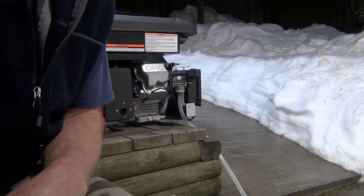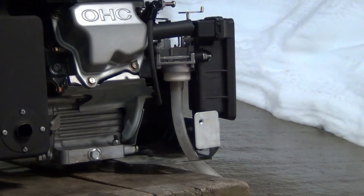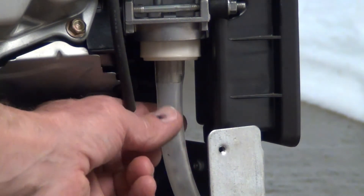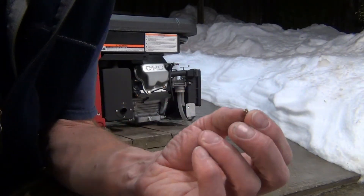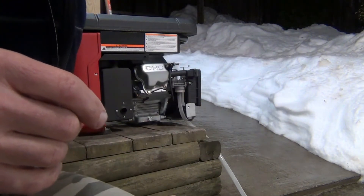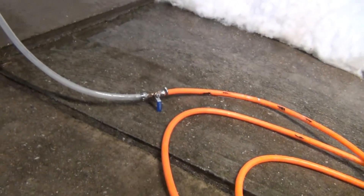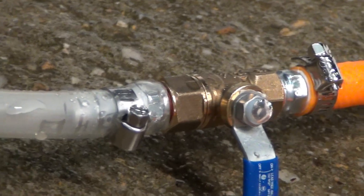What I got here is pretty much a piece of hose from my gas meter, and I stuck it into the bottom of the carburetor — stuck onto whatever that piece is sticking down. I removed the main jet because it would kind of be in the way of pushing the hose inside. So the main jet is out, the hose is pushed all the way in, and I just got a little gas shutoff right there on the hose that is about a quarter inch — hose in and hose out.